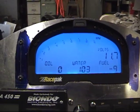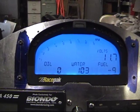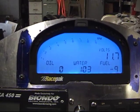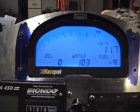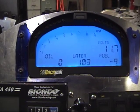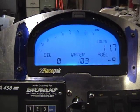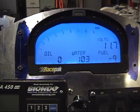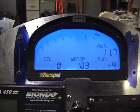It's easy to program in that programming screen we used before. I'll probably do a high EGT warning and possibly something with boost. With my car, if I'm not at 15 pounds of boost when it drops to lower RPM after the shift with the Powerglide, I'm not going to run a good 660. Some guys would want a boost warning light. For a nitrous guy, low fuel pressure or bottle pressure could be a useful warning light — if the bottle pressure is high or low you can purge it down in the lanes or repurge if they shut you off in the water. That would be a good tool as well.